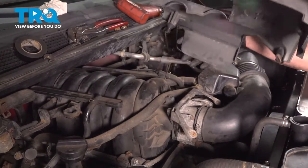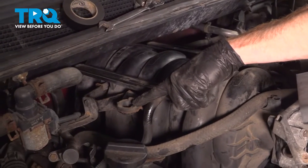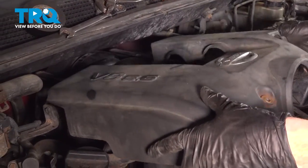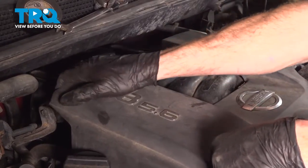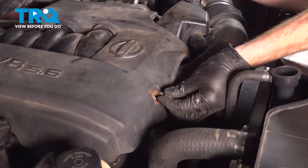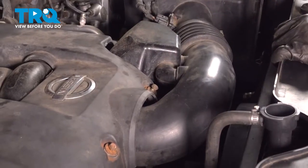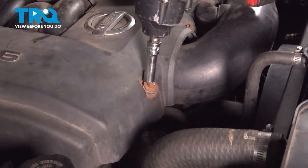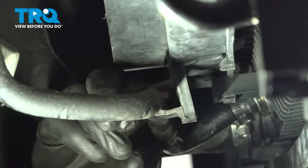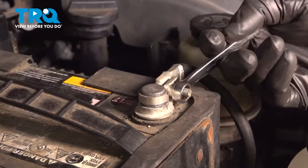Time for the upper engine cover. Look at the bottom side — you'll find two little tabs that protrude down, and on top of the air intake you'll find the ports for them to slide down into. Carefully put the cover in position, line those up, and press them in. Continue on with the two 10mm headed mounting bolts in the front. Now reconnect the negative battery terminal — slide it all the way up against the battery and tighten that mounting nut. Make sure it's completely secured.